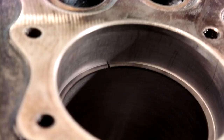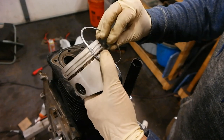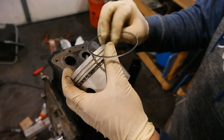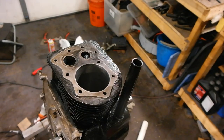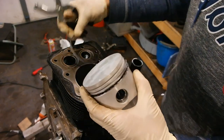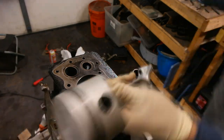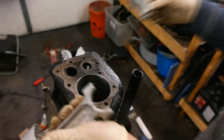When finished we install everything onto the piston. First is the oil ring expander, then the bottom rail for the three-piece oil rings — these are thin enough where you can just walk the rings on. Be careful if you're wearing rubber gloves that it doesn't catch and rip your glove. After those you should use a piston ring expander tool. Next install the scraper ring, and then the last ring is the top compression ring. An important note on installing this type A piston: there's no directional mark on the piston itself, but make sure the connecting rod oil hole at the end cap is facing the camshaft, which is under the valves.